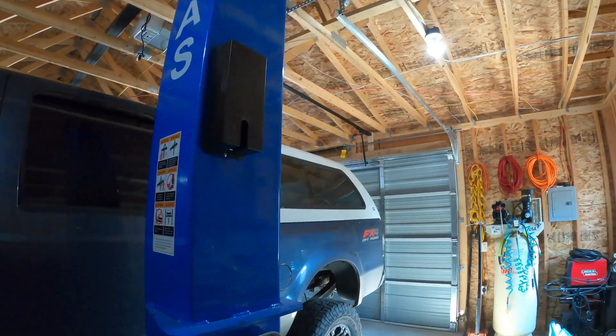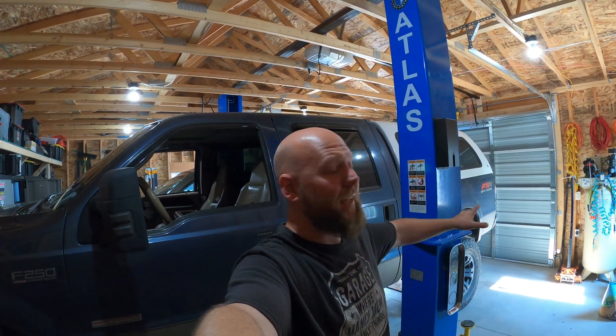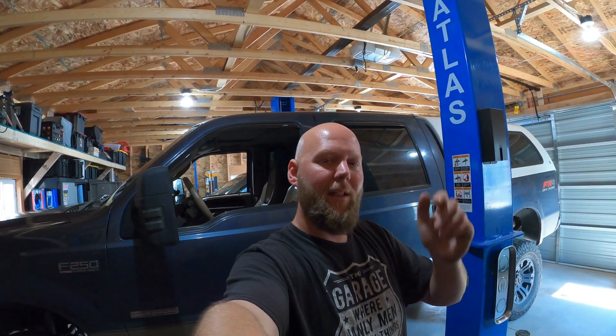That's all there is to it. Your differential is now breathing up in a dry, clean atmosphere with a filter on it, so dirt and water aren't going in. We're way up high in the tail light area so we're well protected. I did the same thing on the front, and we'll probably do the transfer case next time we lift the truck. If you guys liked what you saw, hit that thumbs up, subscribe, and check out my playlist dedicated to F-250s. There's a PayPal and Zelle link below for donations — thanks for watching, we'll see you next time.